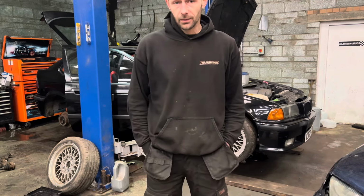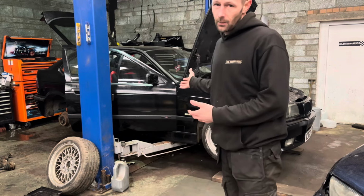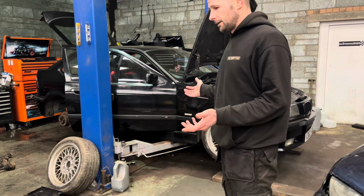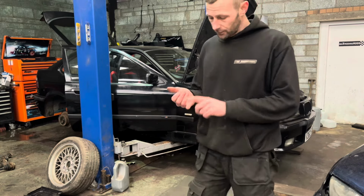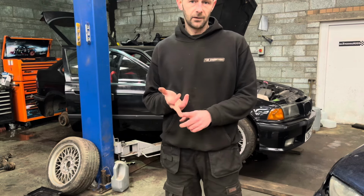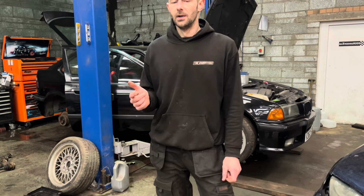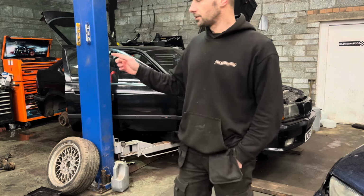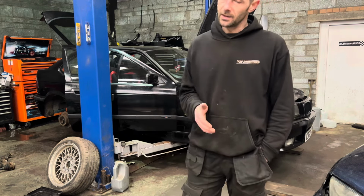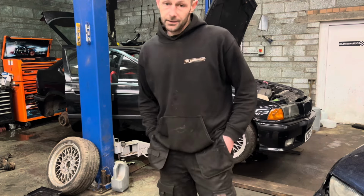In this video today we're going to cover, basically you've done an engine swap on a compact, a 1.8 car, and you've got it running and you have no temp, no RPM, and you have a 5500 RPM limiter. Today I'm going to walk you through how to fix that yourself. So I'm going to take you over and show you the diagrams that I've written for you guys. I'm going to make it really easy for you. So yeah, let's make a start.